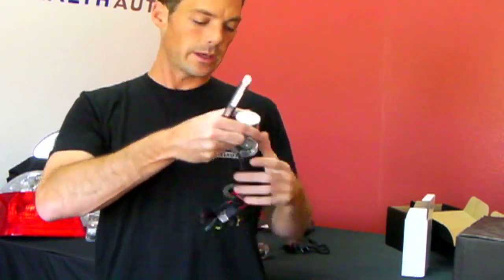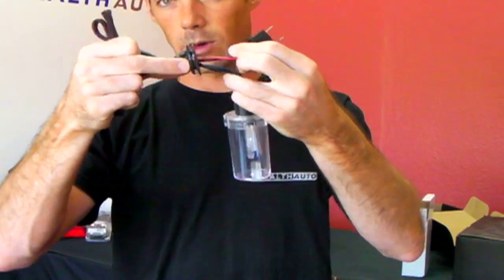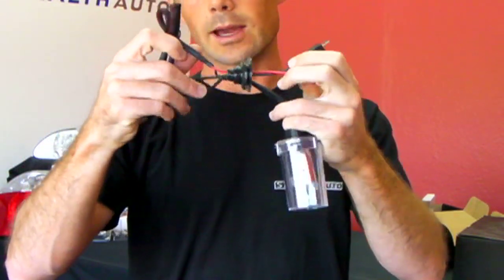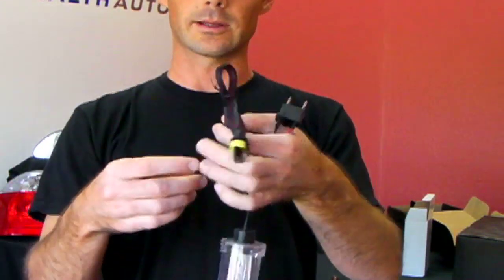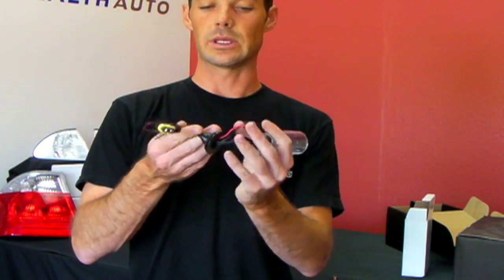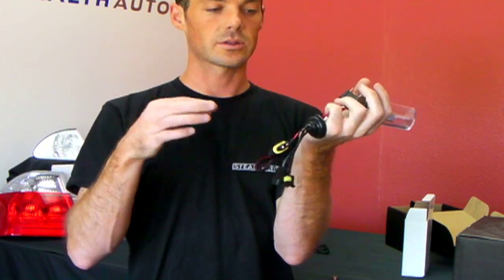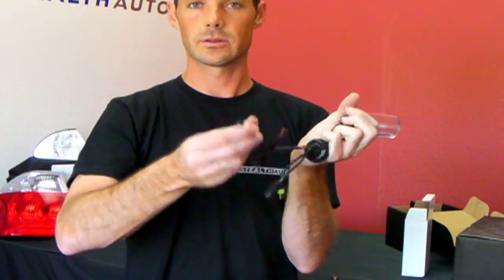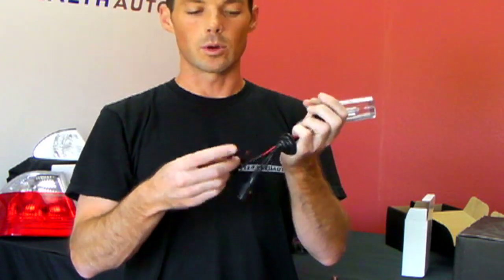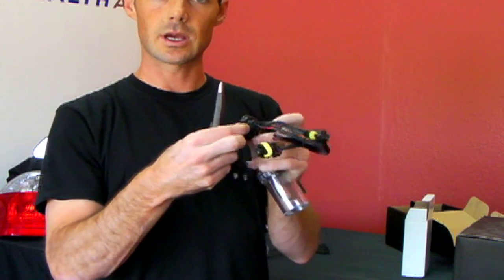One thing about the headlight bulbs — when they come from us, you may notice that there are two sets of wires that go through this rubber grommet here. There are a few headlights that will make use of both of these, but most of them will not, so don't get worried if you plug your headlights in and you have an extra piece. The reason some cars need this is that they have an assembly inside the headlight they want to protect from moisture. On some headlights, the power runs into the headlight and then back out to the high beam. Most of the time it's not used, so what we're going to do for this install today is actually cut the grommet off.